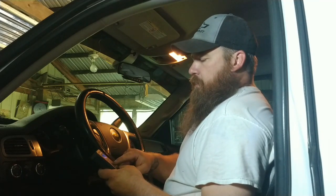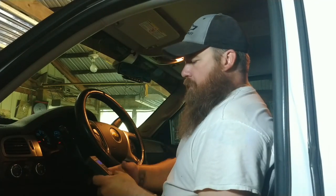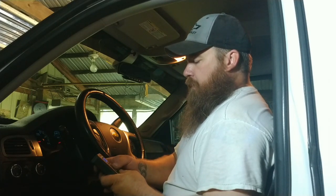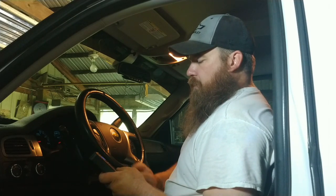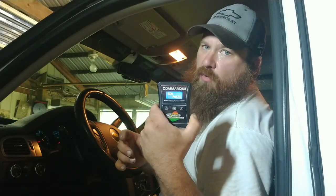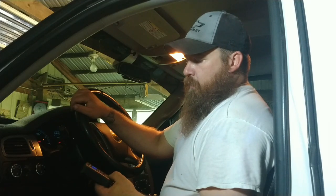I'm going to check my codes right now, which I already have — it's the whole reason I'm doing this, I already know what the code is. I'll show you real quick. It's plugged into my OBD2 port down there — this is just my little programmer for tuning, but it also does diagnostics. It's displaying ECM code P0671, which 671 is glow plug number one. If it was 672 it would be glow plug number two cylinder, and so on and so forth. So I'll show you how to change out a glow plug on these Duramaxes.